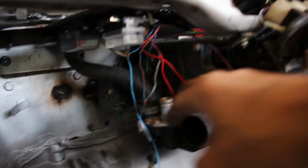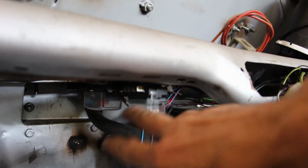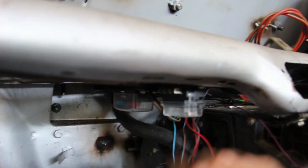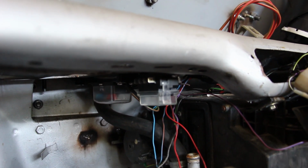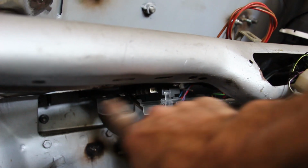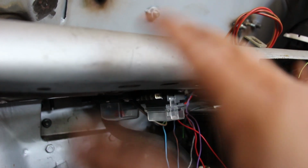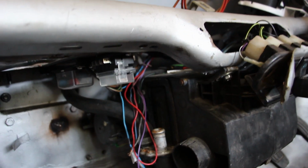To finish this wiring off, we need to put the red and the blue loop through a fuse. We've fitted the second fuse box here now. Basically different purposes. This fuse box is all ignition on power. This fuse box has two loops going through it and two wire feeds which will have a permanent live, fused but permanent live. So that's this one and this one. So we're just going to terminate them on this side, and on this side we'll have those two going in, and then we'll do the loops on this side probably as well. I don't know which way around, just connect these up somehow, and then all the digitals will go right.